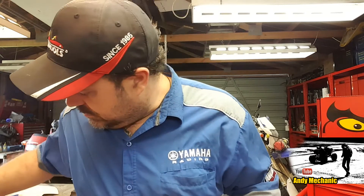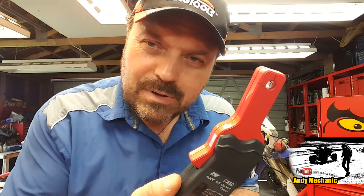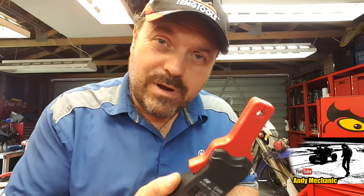Now that I'm getting more into using this one, it does have some limitations I have to work around. The maximum voltage it can work with is plus or minus 20 volts DC, and for things like ignition primary voltage, it's not enough — it's a bit of a pain, but I can work around it. Down here I also have an amp clamp, which is really, really useful. If you're going to get a PicoScope or any kind of oscilloscope device, you really do need to get an amp clamp at the same time.